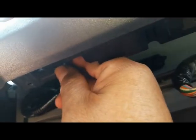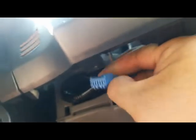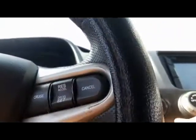There's one right here — the button is to the left side. Push on it, wiggle it, and pull it out. The other one I think is for the hazard light. The button looks like it's underneath the bottom one — push on it, wiggle it, get it out. Then there's one more above the blue connector — the button for that one is on the left side. Put your finger in there, feel the left side, push that button, wiggle it, and pull them out.